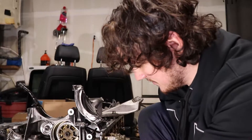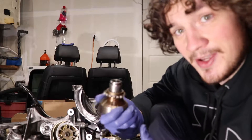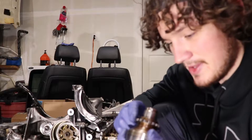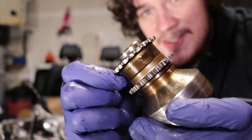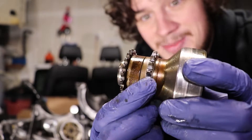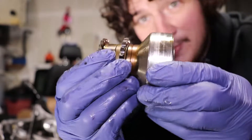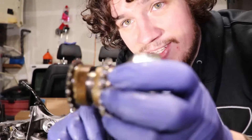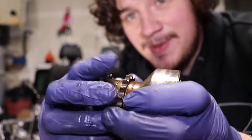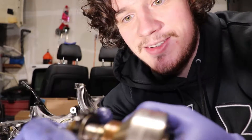Right now I'm in the process of switching over to the VTT spline lock solution for the crank hub on the N54. Let's start by explaining the problem — what causes the timing to slip. We have the OEM crank hub here with both sprockets. This is what does the oil pump timing, and this is what does the camshaft timing. In a well-built car, these would be one piece. Here's what BMW decided to do: they have grip discs in between these sprockets — a grip disc here, a grip disc here, which the oil pump sprocket comes installed with, and one more grip disc right here.